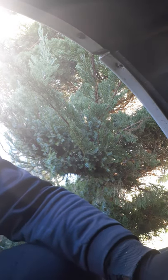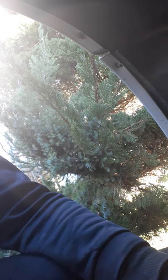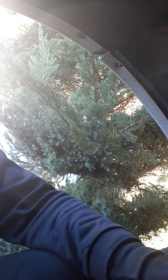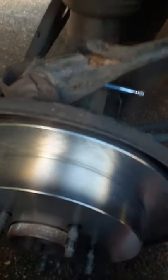These are the new brake pads. This one goes into the piston. This one can be a little bit tricky — I did have a little difficulty installing this on the other side, but this one went in a lot more easily. Bottom side first — you want to install those hooks onto the hardware, and then the rest is simple. Reassemble your tire, let the car down, and that is a brake job. Thank you guys, have a nice day, I hope this video helps.